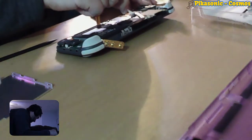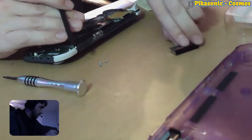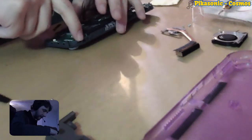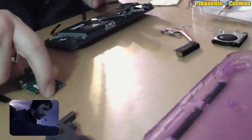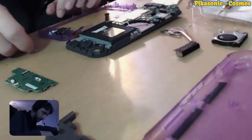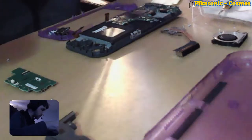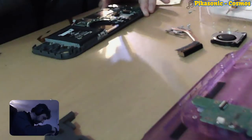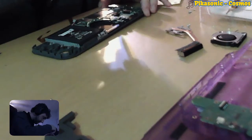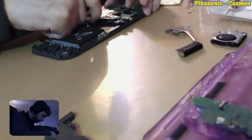Next, you can see me removing the heat sink for the switch. And then I start with the left Joy-Con board and thumbstick. I go ahead and seat these in the new case. That way, most of the work is done for me. Next, I work on the main system board, which houses the other Joy-Con, as well as the speaker.